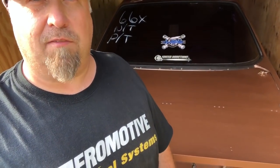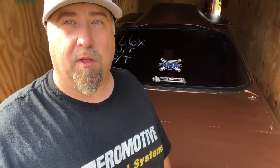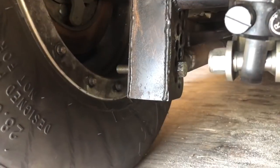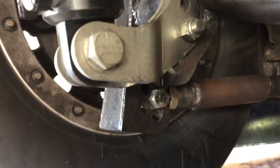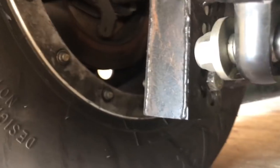On my car, I've got an 8.8 rear end. I have adjustable brackets on the bottom. The upper control arm mount on the rear end is in the stock location with spherical bushings. On the body of the car, there's lots of adjustability on the upper control arm. On the lower control arm on the body, I have one hole one inch down from the factory location, so not much adjustability there. You can see the brackets — there are many holes for adjustability. The more holes, the more precisely you can adjust your instant center.